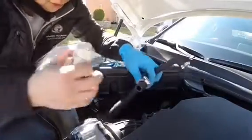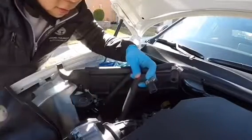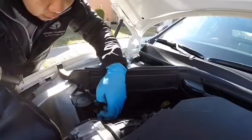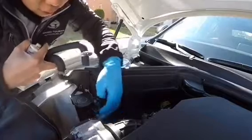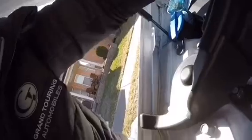What I find helps is to put a very, very thin layer of grease on the ports. This just allows the hose to slide on a little bit easier, and when you have to take them off it's not as much of a pain. Same thing on the PCV valve side as well — just a little tip. You don't need to do this, but I personally prefer it and through experience it does help.